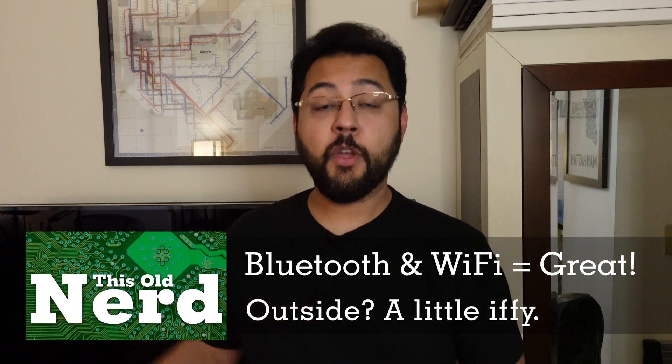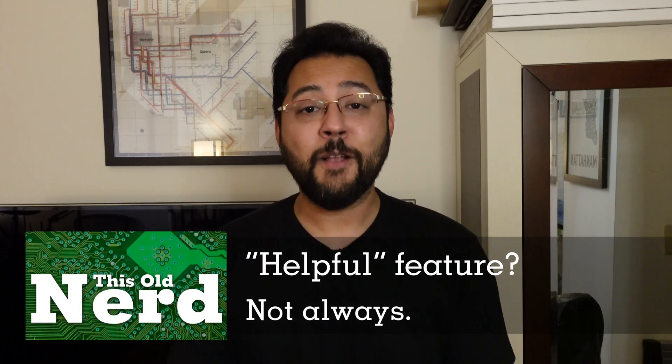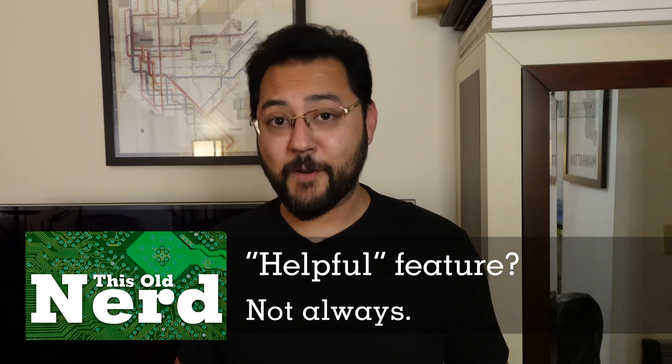Let's talk about the downsides, because it doesn't work every single time. In my experience, the SwitchBot Bot over Bluetooth works almost every single time; over Wi-Fi on the network, almost every single time. When I'm outside the Wi-Fi network, that's when things get a little wonky. I've found better experiences with iOS devices outside the network than Android, because the app was being put to sleep by the battery saver feature. Making sure that app is never put to sleep helped. If you're on Android and wondering why your routine isn't working every time, the app needs to be alive — that's not SwitchBot's fault, it's the power-saving features.